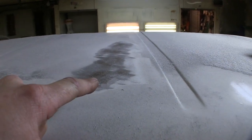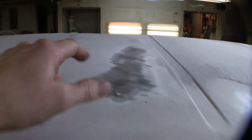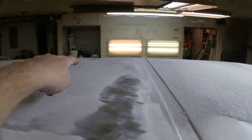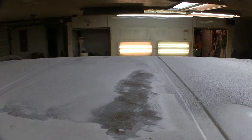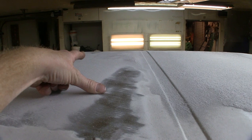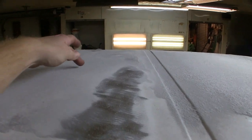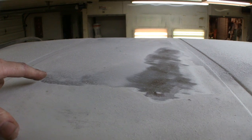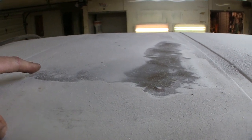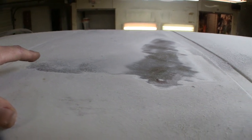Anyway, I'm starting to strip the paint off so I can get my dent puller up here. The biggest problem is it's oil canned — it's bellied out back here and there's a little bit of a doing a little farther forward. I'll clean it up and show you once I get it stripped. There's a pretty hard dent down there and it's oil canned right in here — it goes 'whing.' So I've got some shrinking to do. I could not let this go out the door without fixing this roof, even though I don't think it was in the game plan.